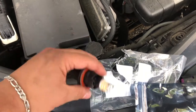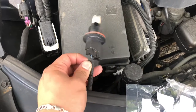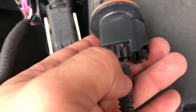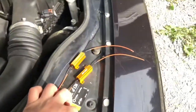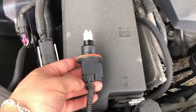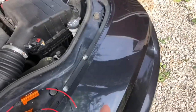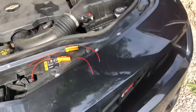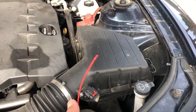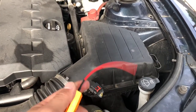Go ahead, grab your LED and pop this one into place — and there you go, that's your LED. Now you gotta peel this wire back a little bit. There's only two wires, so you connect one side of the resistor to the black one and the other side to the blue one. On this car I don't know if it's the same color, but there's only two wires so you don't really have to worry — it just goes one to the negative and one to the positive, so it doesn't matter which one goes to which.